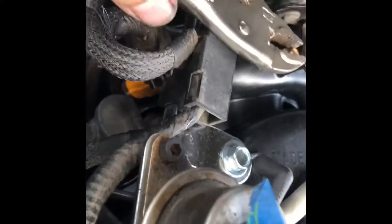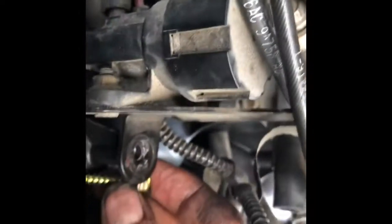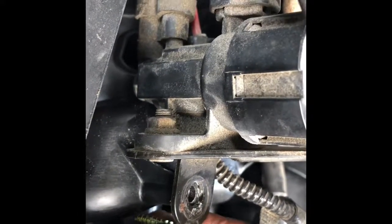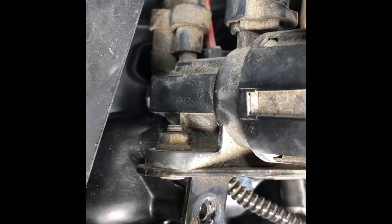I had to cut this side off too. Here you can see where I've cut it off, and if you look, you see how long that plastic riser is. You can even tell by looking that if you put the new bolt in, it's going to be too long. It's going to stick down into the air passage, and I doubt they drilled the hole all the way through. So I think they just needed to put some shorter screws in with the packet.